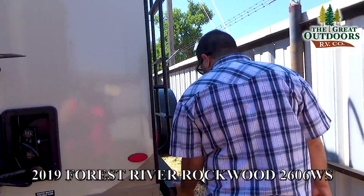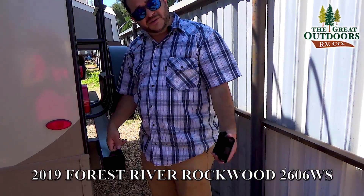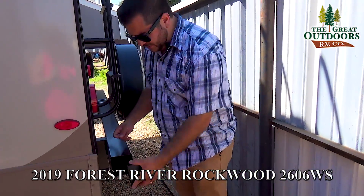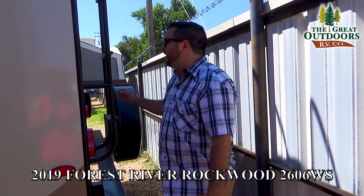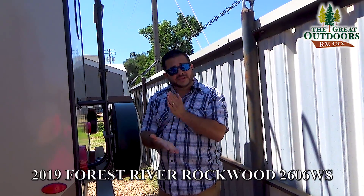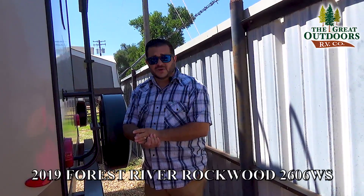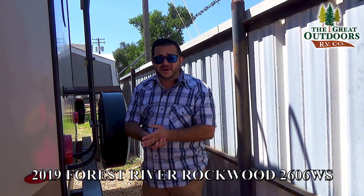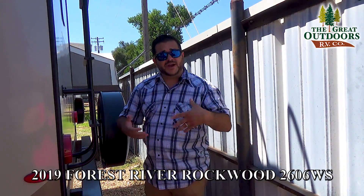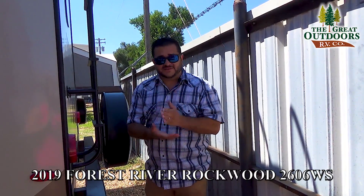Moving towards the back, I have a little spot for my waste hose so I don't have to put it under the underbelly next to my waters and food. I do have a backup ladder — it's important, guys. Check those seals. Check that roof condition. Make sure everything is nice and in order. That's how your problems start — you let two or three years go by without going up there and a little crack turns into a big crack. Now you've got water damage, broken vent lids and stuff like that.